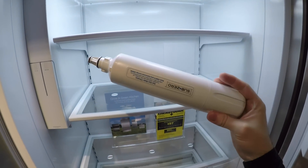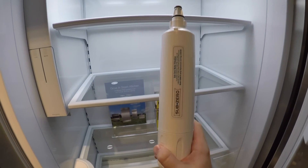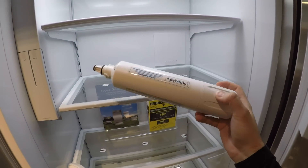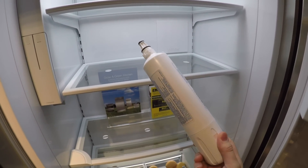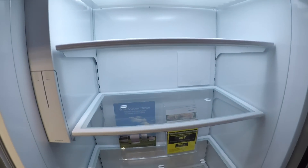You've also got your power and alarm toggles here. The water filtration system is also really high-tech — it's located up here, and changing your water filter is really simple: just a half turn and it pops right out. Look at the size of that — it's one of the best filters on the market for water filtration, the same size as some of the EverPure and high-tech on-tap demand filters. It will filter out bacteria, viruses, particulates — they have a full listing on their website. A lot of clients hook this up and no longer need a separate whole water filtration system.